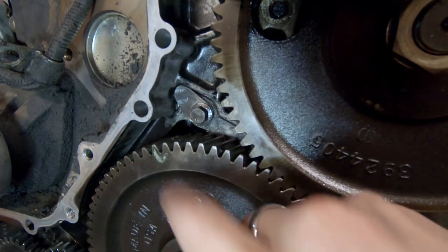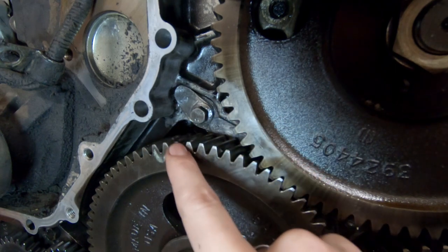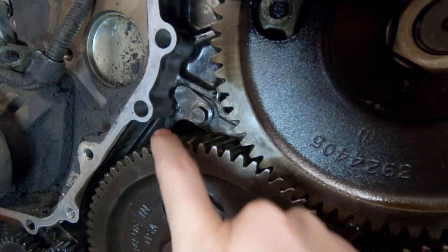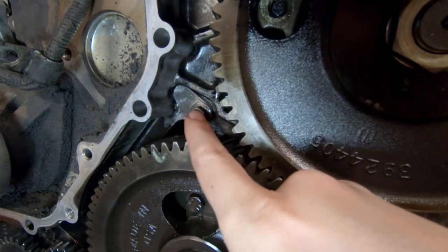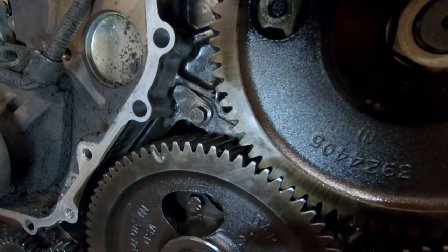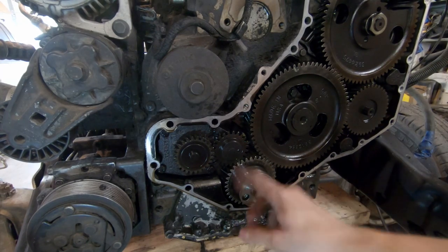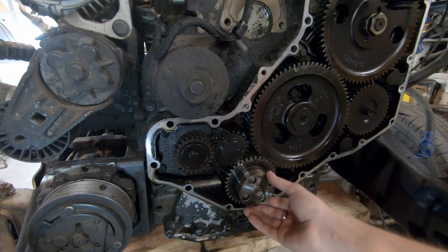There is the finished product. I wanted to make it long enough so that it couldn't rotate down into this gear — so keep that in mind, make it long enough that it gets stuck and can't rotate down and hit the gear. It's pretty easy to do. If you have an angle grinder and a drill, you can easily do this yourself, otherwise you can just buy one of these kits online. Now that the killer dowel pin is fixed, the other thing I want to do while I'm in here is the front seal — let's do that next.